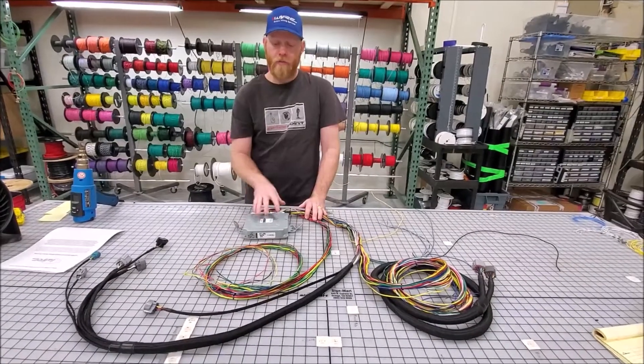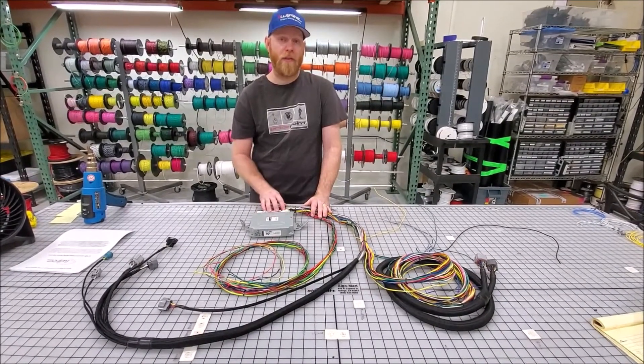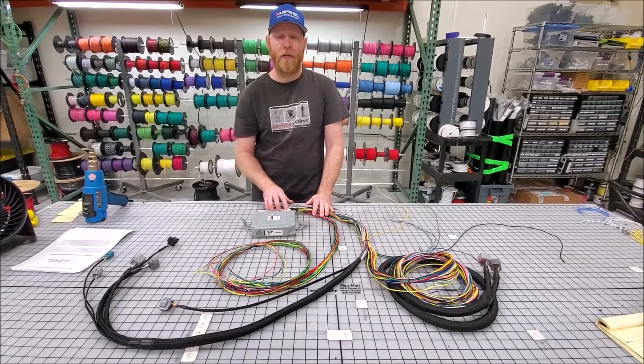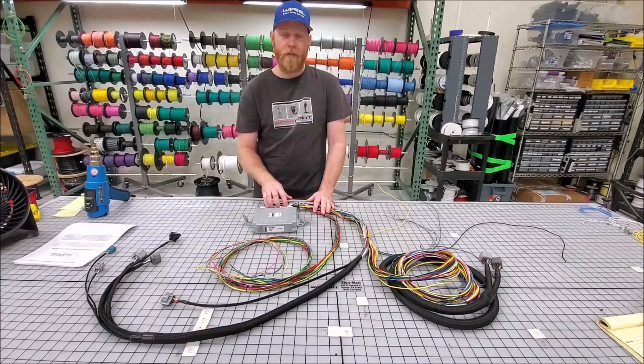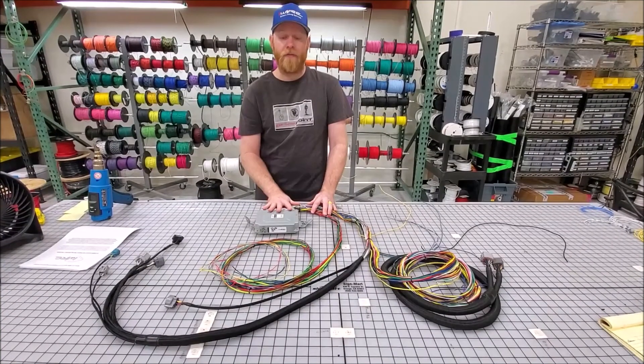If you start with a US WRX and sometime in the future go to JDM WRX or STI, it's plug and play and you're ready to go. This would be compatible with any plug-and-play standalone ECU designed for the 2-liter WRX. The two big ones that come to mind are Link and Haltech — Link is a direct plug-and-play, Haltech will use a jumper, but either one will work great.